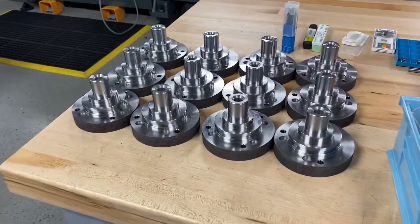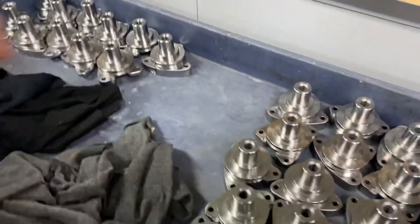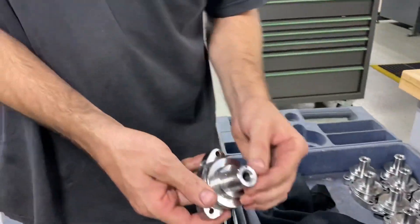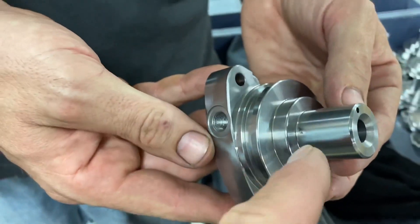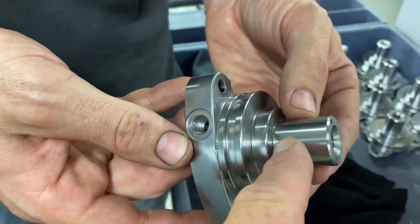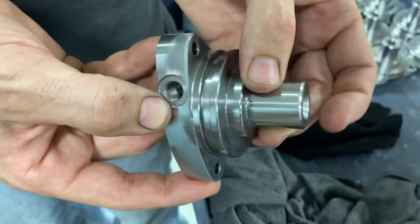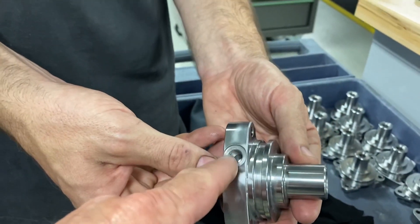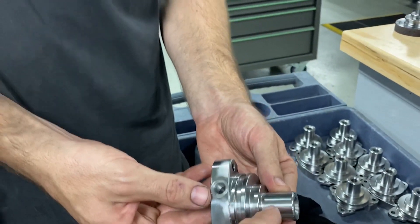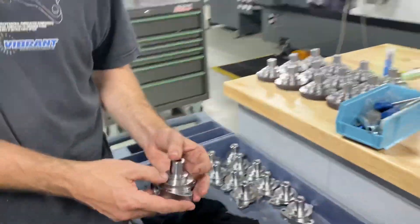The IMS solutions come over here like this, then they machine them out to the final product. They've got an oil drill — that way the bearing material gets lubrication. There's one more hole that'll go in here, so it's fed from the front and fed from the sides. Here's the NPT port where the engine oil comes in to lubricate this, because splash lubrication just isn't going to cut it — you need that pressure.